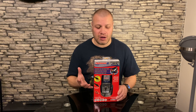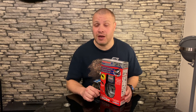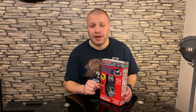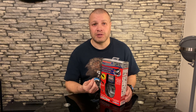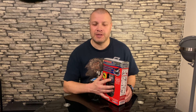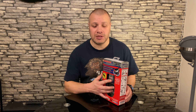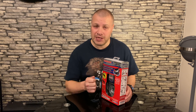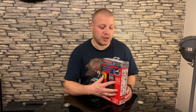I wanted the convenience of just plugging into the DIN socket on the BMWs. The problem with that is — I used to do it on my Triumph Tiger, no problem at all. But on the BMWs, the CANBUS is connected to the charger port and recognises if nothing's attached. So if the charger shuts down for a period of time, the BMW ECU switches off that port, and when the charger wants to charge again, it can't see the battery. So if you want to use the DIN ports on the BMW, you need a charger designed for CANBUS, which keeps that CANBUS signal open so you can charge through it.